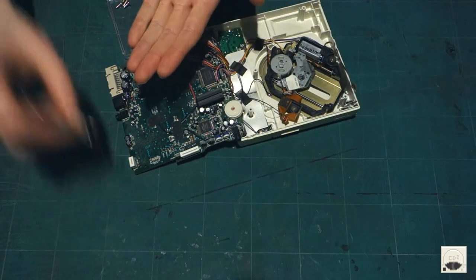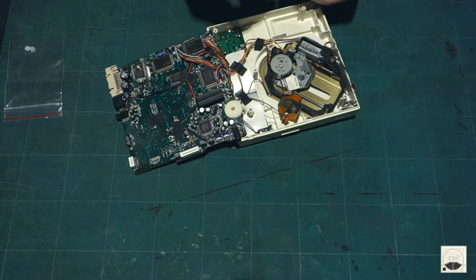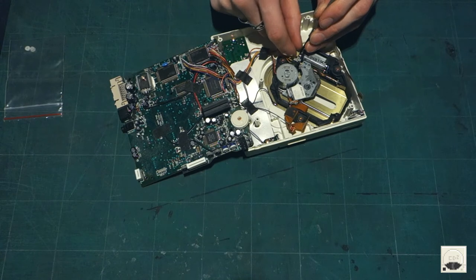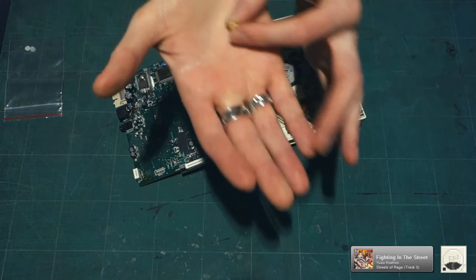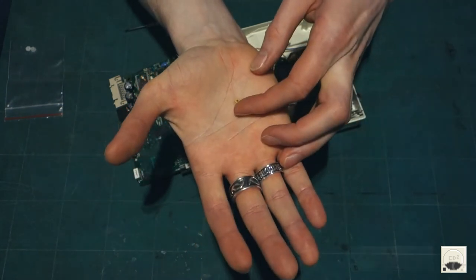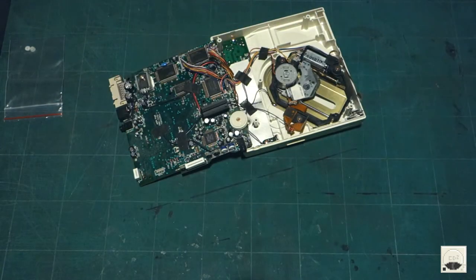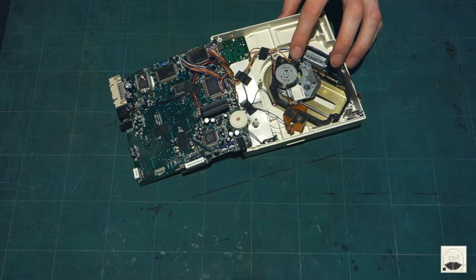So I'm going to use my little screwdriver case. Let's just make sure that's dropped in there. So now hopefully this should just come off. There we go — that's off. You can see that and hopefully it will zoom in for you — it is tiny, it is really tiny. The teeth, one of the teeth is actually gone on it. Yeah, good decision to change that, because that probably would have broken after trying to play something for a couple of minutes. So I've got spare ones here. I'm going to leave the motor separate so I can move this spindle and clean the spindle properly.